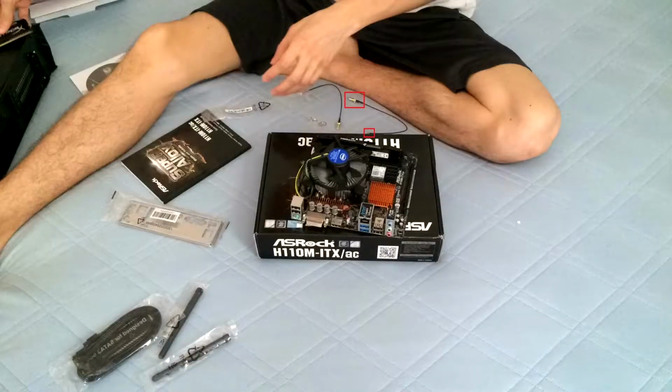The Wi-Fi on the motherboard was difficult to install, but I somehow managed. You're required to place the wires with the gold rounded pins at the end onto the tiny gold ports on the Wi-Fi module, and then apply pressure. It should click. Many reviewers, Newegg, PCPartPicker, complain about the difficulties of installing it, and some even destroy their Wi-Fi somehow.